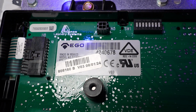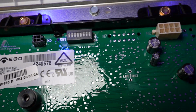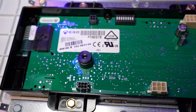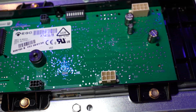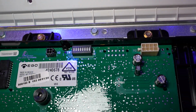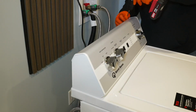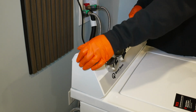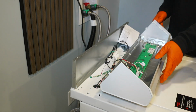Next, the TR7 has the same interface board as the FF7, so the look and location of the dip switches are going to be pretty identical. I haven't repaired a TR7 before, but my best guess on accessing the interface is going to sound like this. There should be 3 or 4 Torx screws on the top of the unit that would need unscrewed. Once done, you'd roll the panel forward to access the interface of the machine.